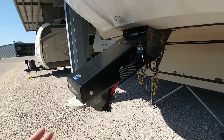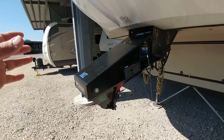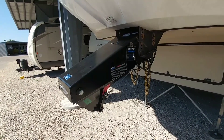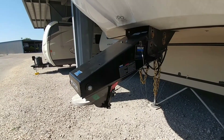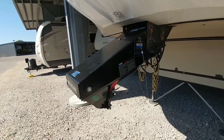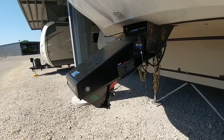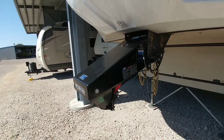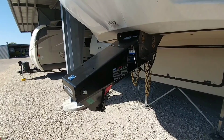Just because you use an adapter does not mean you are going to damage the front of your fifth wheel. It's actually pretty unlikely that the adapter's little extension arm is going to damage the frame. Where you typically see damage is if you go over really adverse conditions — maybe large expansion joints continuously, such as driving through interstates in states that are poorly maintained or have sections of overpass with continuous overlapping expansion joints. Most people will probably never experience any type of frame damage or failure, but Lippert has received claims saying the front of the frame was damaged when using that type of adapter.